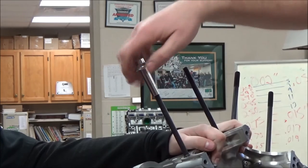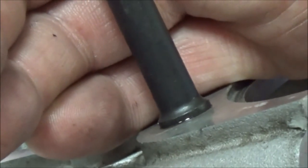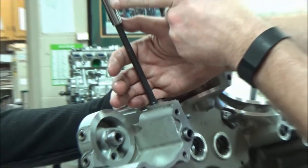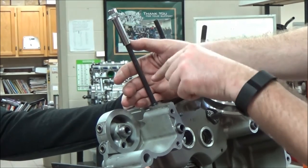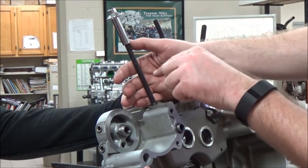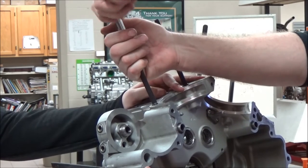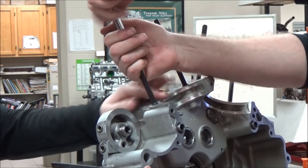You can see here the stud stayed down. What we're trying to show you is you can actually see where the Loctite has spilled out a little bit, and that the flange is flush with the case. When you're removing the cylinder, if the stud started to lift on you it would not be able to do its job — that's why placing that little ball on here is so important.